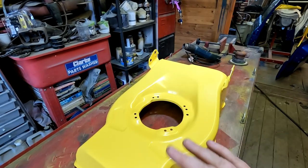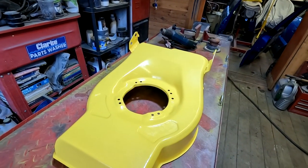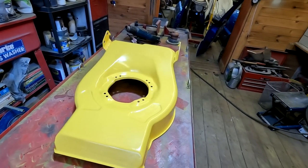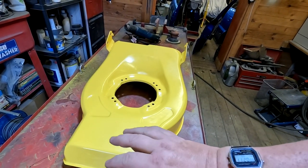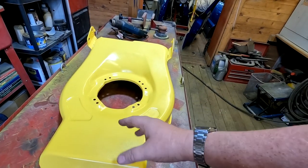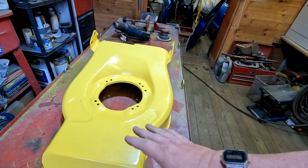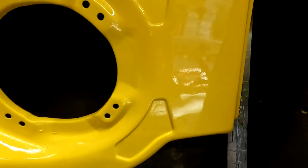Well, if you remember from the last video, I powder coated over the Vactan rust treatment, which I've never done before. Around where the Vactan was, I treated it and left it on there, and it basically didn't really cover and it reacted and lifted. So I sanded it back and put it back in the oven and it took all right, apart from a few little spots.